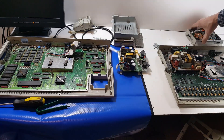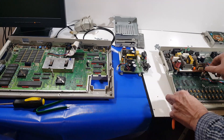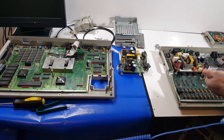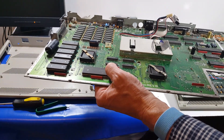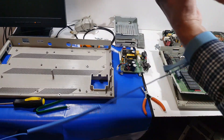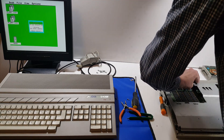So I made the decision to swap the two motherboards. Once I finally got the second motherboard working, it was much more stable and didn't have any of the interference or video issues. I went ahead and swapped them out — as simple as that, just pulled one from one and moved it to the other. And as you can see, it boots right up and there's no more video interference. It looks great.